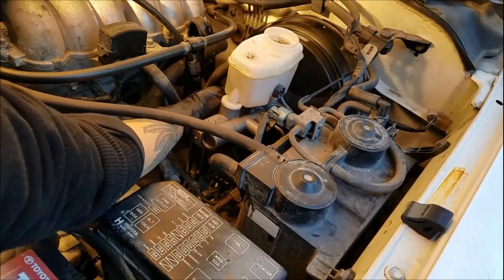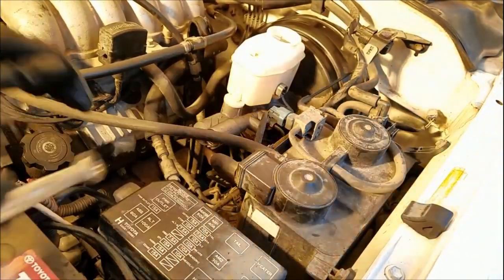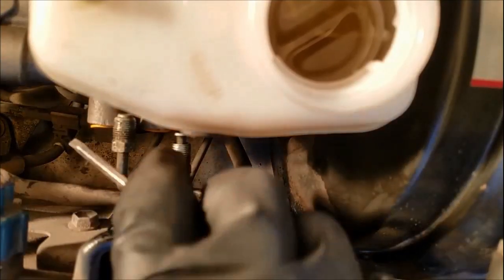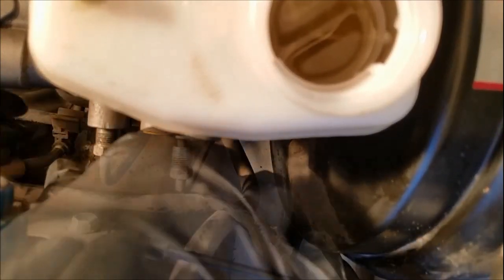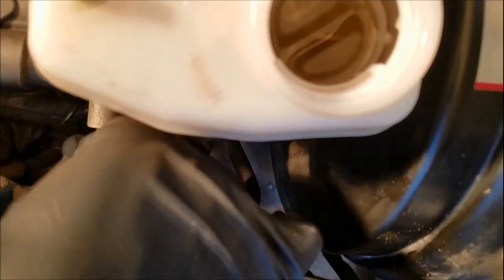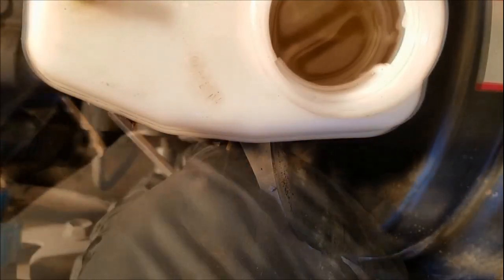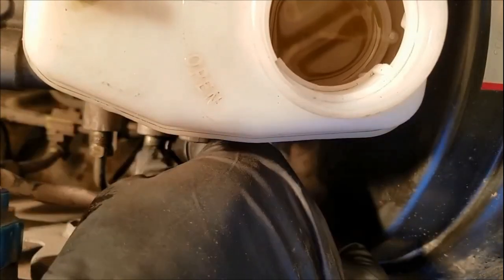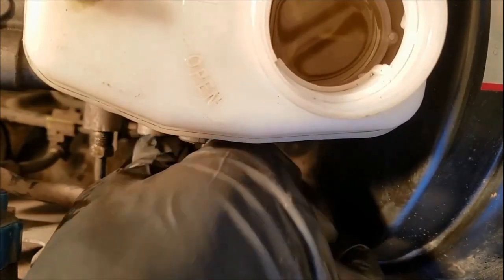You can see that I've installed that little plate before installing the inner 12 millimeter nut, and now both nuts are installed and tightened down. Removing my little plugs now, which kept brake fluid from spilling on my engine bay paint. Be super careful and thread these brake lines in by hand first — the torque specification is only 8 foot-pounds, so be really, really gentle.